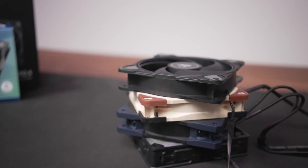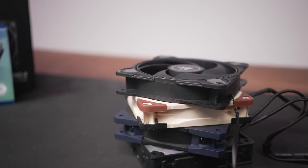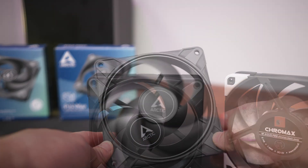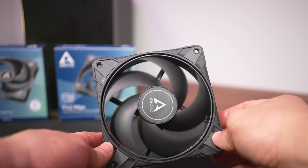If you just need the lower RPM range, you can also save about $10 for the non-OC version. The P12 Max continues to impress — in this particular use case and RPM range it's smoking the NF-A12x25, and that's just how good this fan is. It's just a fraction of a degree behind the Mobius OC in noise-normalized testing and a fraction of the cost of any of these other fans. If you're looking for a no-nonsense fan to deploy in this scenario — like if you need a quality fan upgrade for your air cooler to run the C14S this way — this is the super sensible recommendation, and it has continued to impress me.